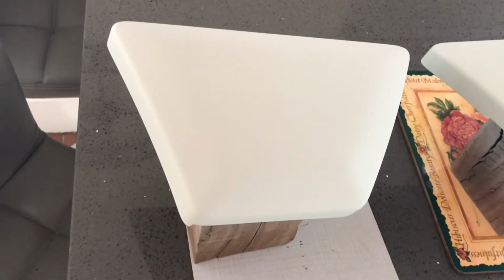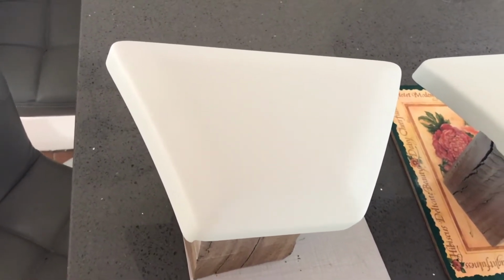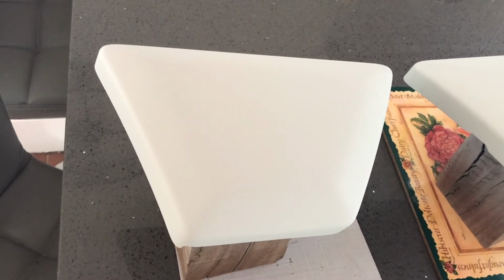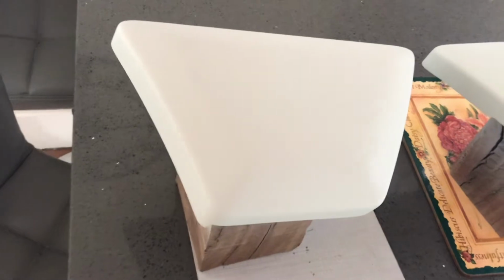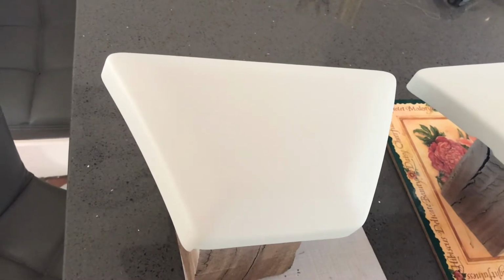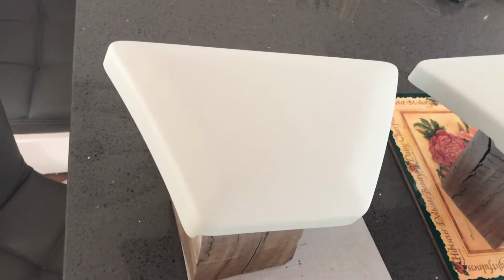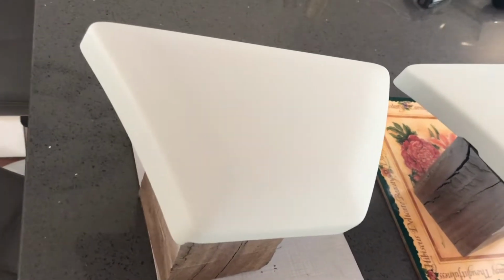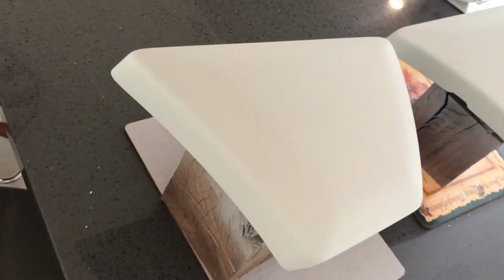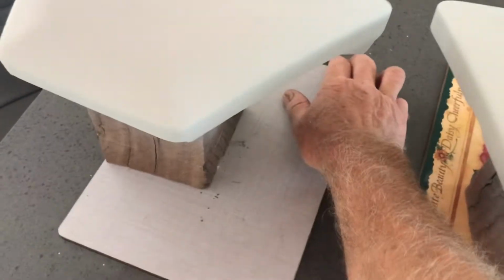You can tell. So, having done the preparation in the previous video, I then gave the panels a wipe over with universal thinners just to clean any grease off, and then I wore latex gloves because fingerprints, you've got oil on your fingers and it can affect the adhesion of the paint. So I wore latex gloves, and this is 3 coats of the plastic primer, and it's come out really well. There are no runs or anything.